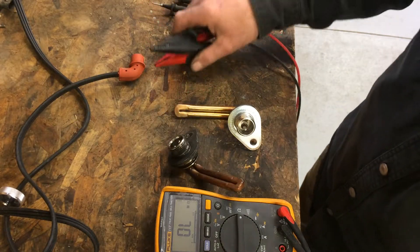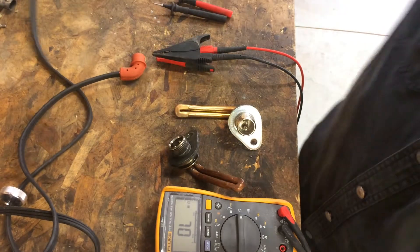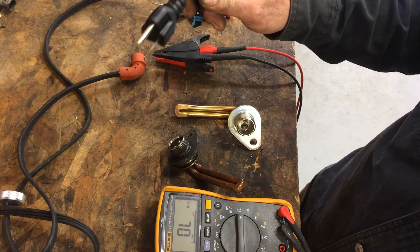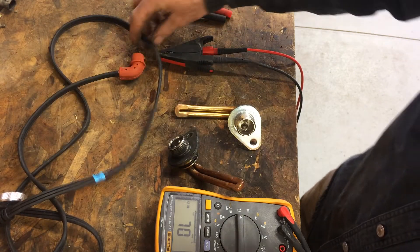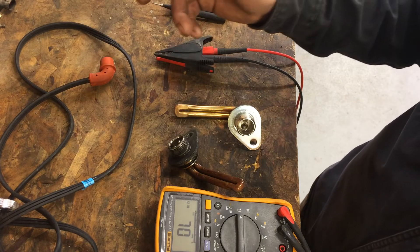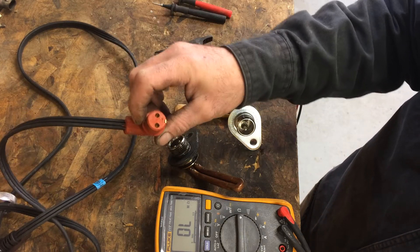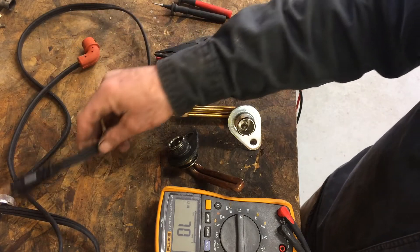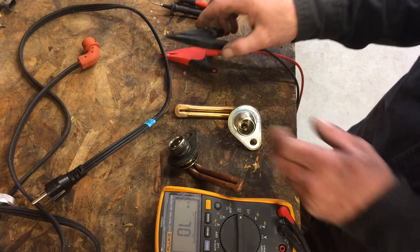You can test that outside of the truck all from the tip of your plug. After verifying that the cord is good, you know the element is bad. If the cord was bad, you wouldn't have voltage here and you'd know it was the cord — get a new cord, plug it in, then do the resistance test back to your element.